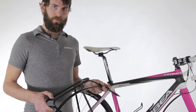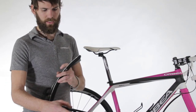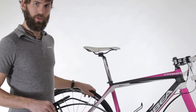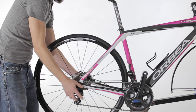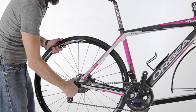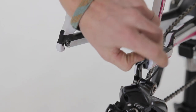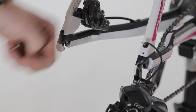With the rear rack and fender setup, you want to go ahead and assemble the fender and racks together to get started, then drop the rear wheel off the bike to give you access to the mounting points. You'll need to take the adhesive covers off of the mounting points.